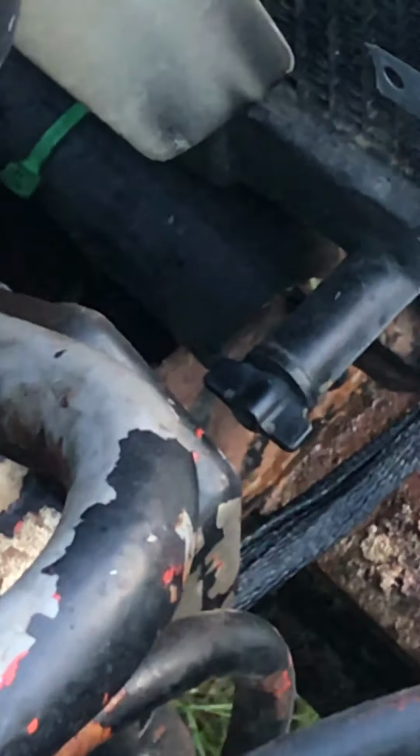Okay. And then we'll go ahead and start draining it. All right, it is draining. The radiator definitely looks somewhat cleaner, I guess. All right, now I'm going to turn it back on, and this time I'm going to put the remainder of the water that I have in there to flush it out while I have the petcock slightly open. It's closed right now.